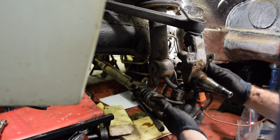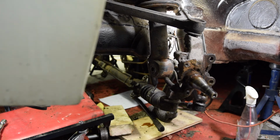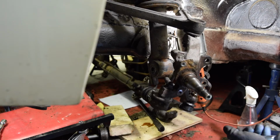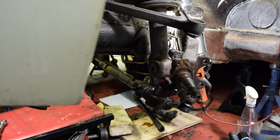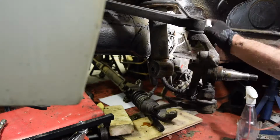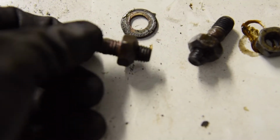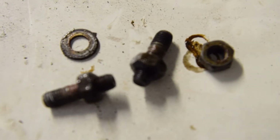Let's have a think whether we go straight in for getting the suspension strut out, or let's have one more go at this steering rack. See if that one's coming undone now. No, I can do that without any adapters now. Got it. Okay. So that's off now. That took a lot of work, didn't it? Interestingly, taking the nuts out of the top of the suspension damper assembly, what you want to call it, it's taking the entire stud out, so these nuts were obviously sort of rusted on quite tight. One of them came out correctly, luckily.